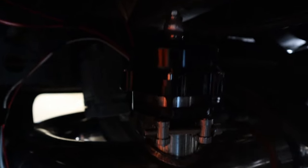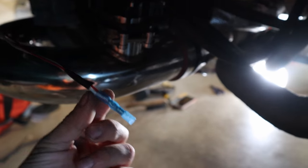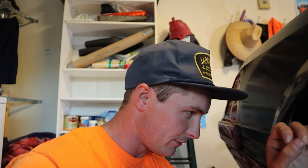They're all hanging down. But here are my pulse width modulated leads, and I'm going to take it through the fender well, up and around, and come out through there somewhere. That shouldn't be too hard, it's just doing it. I have multiple different pulse width modulated outputs I can use. The one I'm going to use is VVT, because I will never use VVT, variable valve timing, ever. Fan control is on the other side of the car, and I don't want to go out to the whole other side of the car just to wire that in. So I'm just going to take this one for VVT on the expansion harness and bring it over here, and then we can pulse width modulate this thing. I'm going to give it a test run, and hopefully it worked and we did it right.